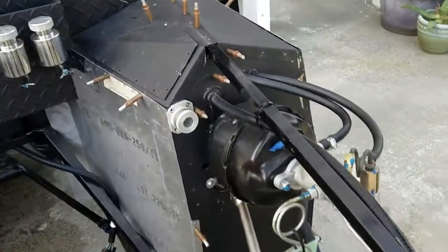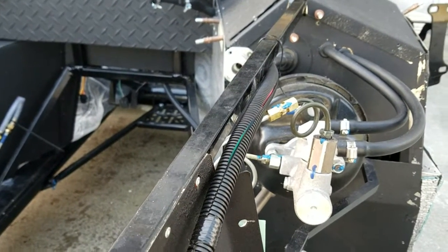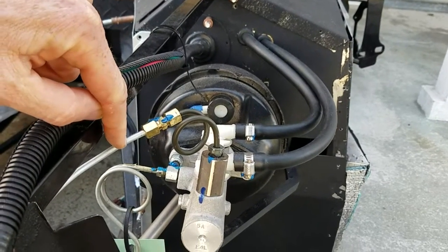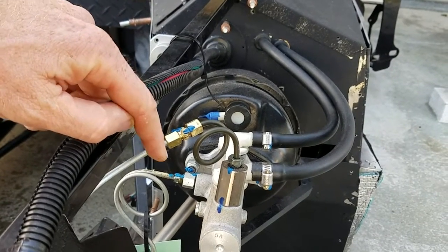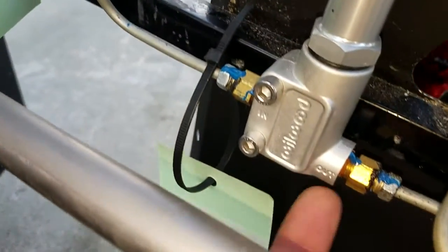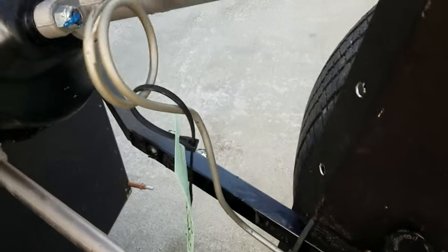I've got fluid in the brake lines, and when I was pumping the pedals, I was finding leaks. One leak was here where I brought together this line plus the flares, obviously, and it was leaking back here. I had cut off that end, and I put compression fittings on both sides, so this leak is gone. But I had just found that I've got one on the other end of that line that I made, so now I need to take out that line and replace that.